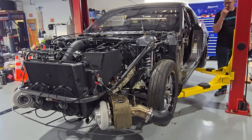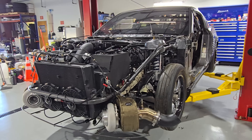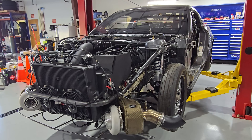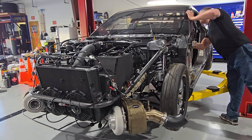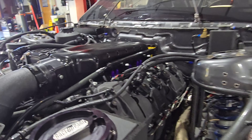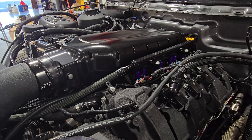That's a pretty badass cold start for M1 — usually it's chugging for a bit but it just works. The car has twin sets of 2600cc injectors. It idles off one set and the other set is staged, coming on whenever it's needed. The blending is like the factory direct injection 2018 setup — blending control over primary and secondary 2600s based on boost and RPM.